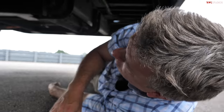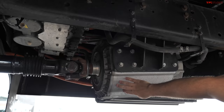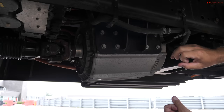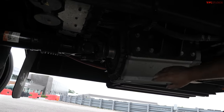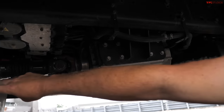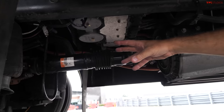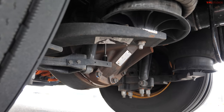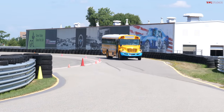I'm behind the rear of the bus to show you the motor. This is the way it's in production right now. In the future, there will also be integrated e-axle solutions. It can produce upwards of about 300 horsepower and monstrous torque, but of course it's not about speed — it's to get the children safely to and from school. It's connected via a driveshaft all the way to the differential, so it's kind of a pusher setup with the motor in the back powering the axle. In the future, these motors will be smaller and integrated where the differential currently is.